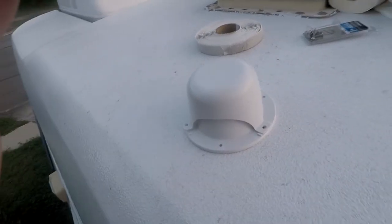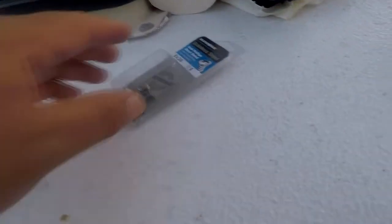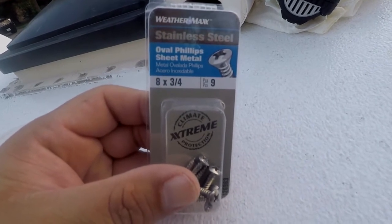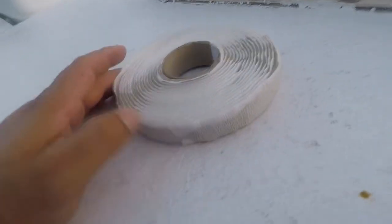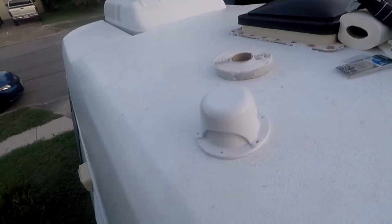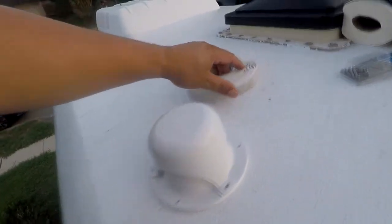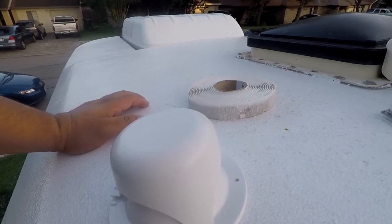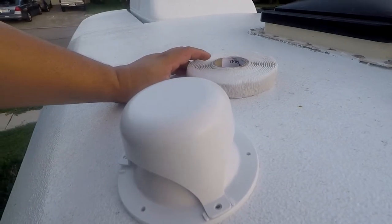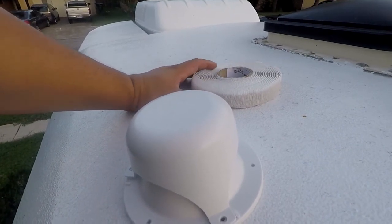Here's what it's gonna look like. For the screws — three-quarters might be right, but definitely number eight is — the most important thing is to make sure you get stainless steel. I'm also gonna put some putty underneath the cover. I learned this when redoing these windows — people call them submarine windows or starlight windows. I'm putting putty around the bottom to create another seal, making it extra safe. This putty is about 43 cents per foot — keep it in your fridge.